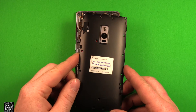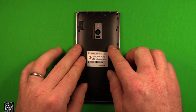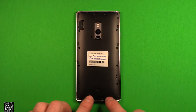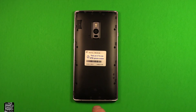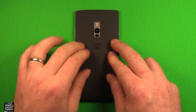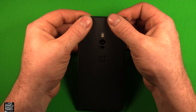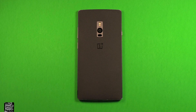To put the back part back on, grab it, set it down, press down, clip it in, and put all your screws in all the way around. Once the screws are back in, put the three plugs back in here and the three rubber plugs in the bottom. Install your SIM card, then grab the back cover, set it down, make sure it's pressed in all the way around, and you're all set. Thanks for watching.